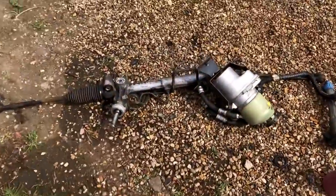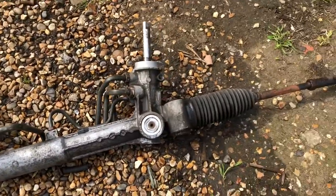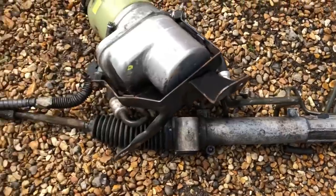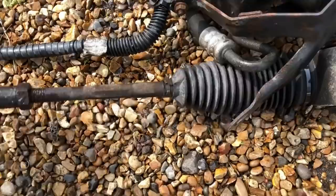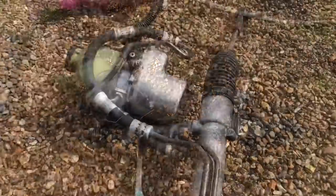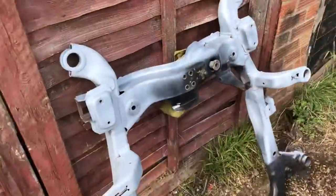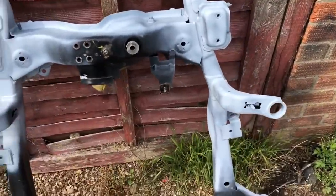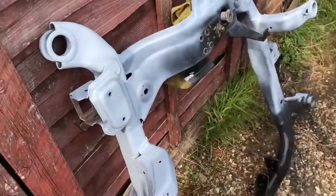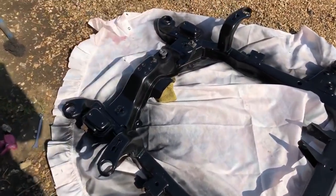Just giving the steering rack a scrub — the pump mechanism was a bit grubby. I tend to go over the top but I don't want to make this absolutely mint. Got new tie rods — these are all coming off. Going to bolt the rack on first because it makes it a lot easier. Not going to get too serious into cleaning this, then it's going to get some frame-all primer and I'm going to go over it with satin black — no need for gloss. Nice satin black like the original finish, then we can get these bushes in, get the steering rack bolted on, Whiteline anti-roll bar bolted on and start mounting the subframe back up.